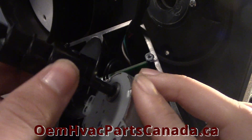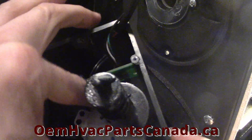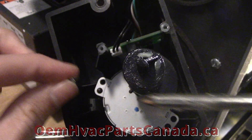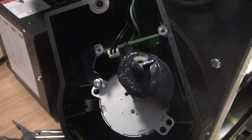Step 19: Secure the black shaft to the damper motor. Step 20: Carefully navigate the motor back into the casing, while at the same time guiding the shaft to interface together with the electronic board. Step 21: Using either the set-aside screws or the new screws provided, go ahead and secure the damper motor in place by screwing in the retaining screws.